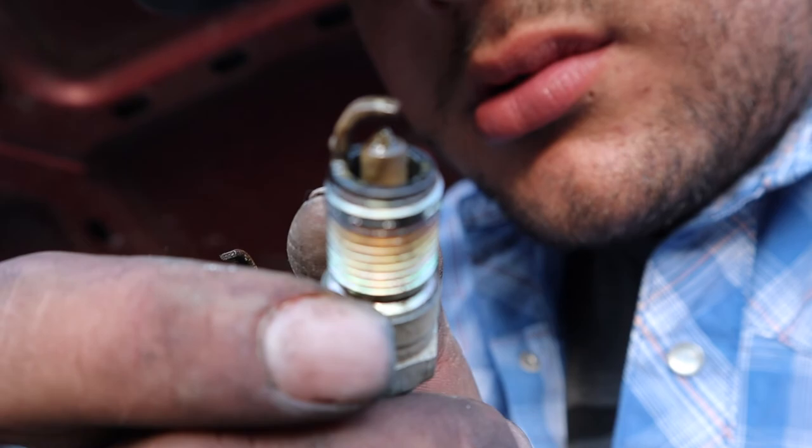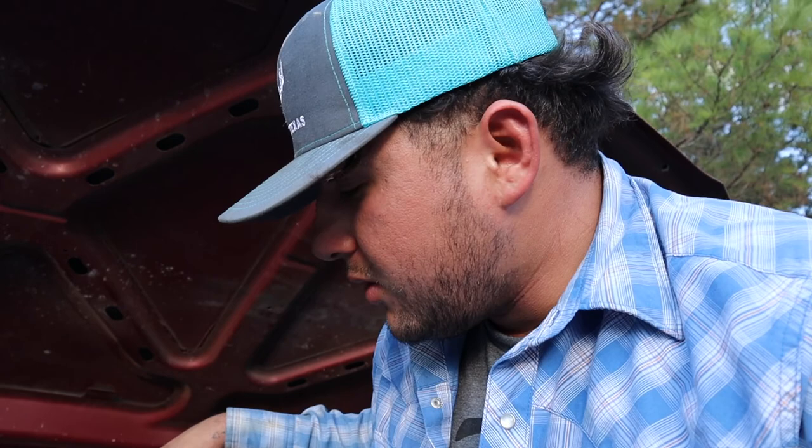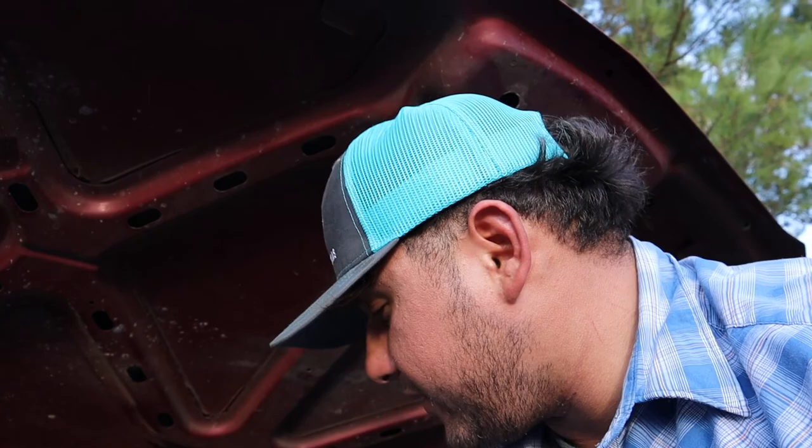So, for example, if I was to buy this truck and I had the key and didn't know, and I was to crank it, I would have messed up one of the valves or one of the rods. It would bend. So if you ever buy a flooded car, don't ever try to crank it up. Don't ever try to start it without checking if it's full of water or how high the water went on the car.